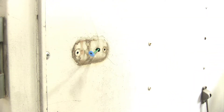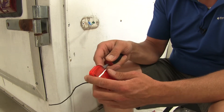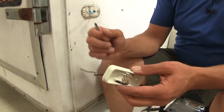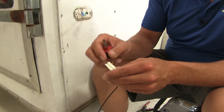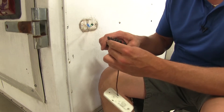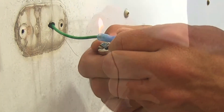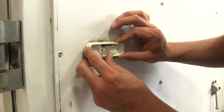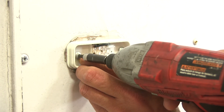Now we'll get our light and pop the cover off. There's a little seam here — just get a screwdriver or a soft piece of plastic in there and pop that off to get access to the inside. You'll see the little ground wire; we're going to use that. Put one of our screws through to secure the light to the trailer so we can get our ground connection there. The other wire we're going to strip back and add to the butt connector, then shrink that one down the same way. Tuck the excess in, line the light up, and secure it from the front side first, then the back. Notice I'm putting the ring terminal over the screw — just be easy with it so you don't damage that terminal.